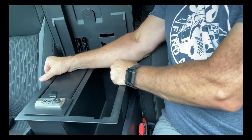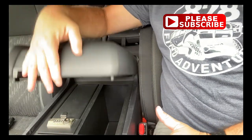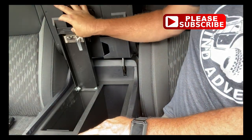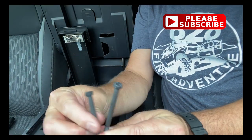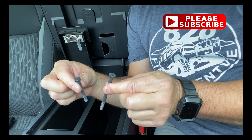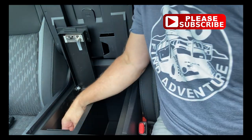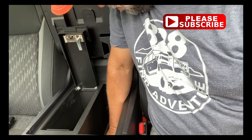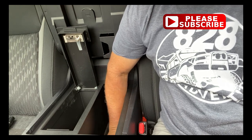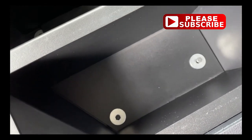Carefully bring the safe into your vehicle because it's heavy — you don't want to bang it into something and do damage to your interior. Set it in the hole of the console; it won't just drop in. You have to tilt the lid of the console forward a little bit and then it will drop all the way in — watch your fingers at the same time. There are two short bolts and two long ones: the short ones go towards the front and the long ones in the back. The console has recessed areas where these bolts go in, so only the short ones will work up front and the long ones in the back.